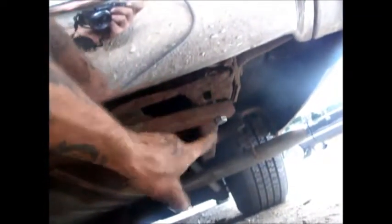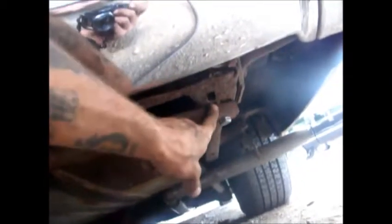I got that angle iron welded in there. I got these pieces made up with bolts going through it up into the frame here with a big washer to fill in the big hole. Then I put a square plate that comes with the trailer hitch — I had some left over, real thick, like 3/8 steel — stuck that up on top of it to reinforce it. Some will say you don't want to drill through a tube like that because it will crush it, but this is thick wall, and it barely has any room on either side of it. This is just side-to-side support for the hitch — it's more in shear than in compression — so it will be fine for what I'm doing with it. I'm not pulling a house with it.